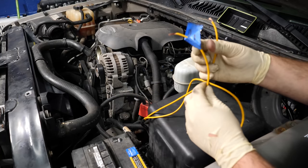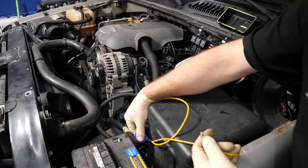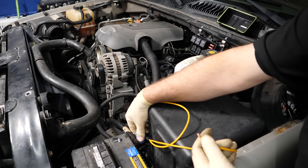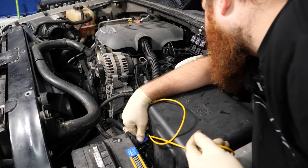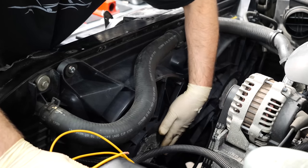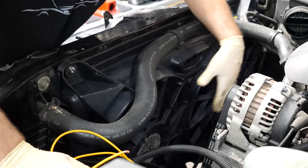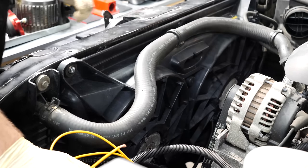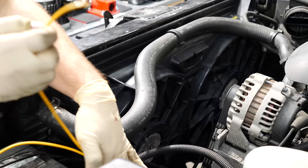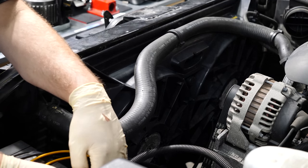Let's start out by grounding the low speed. Both fans are on and both are pulling air, so I didn't reverse the polarities. Now let's say you turn your air conditioning on — high speed. Oh yeah!